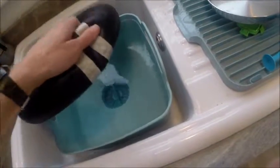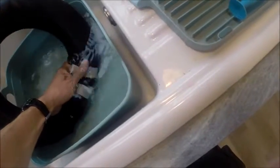In this instance I know where the puncture is. If I put this underneath and squeeze, you can see straight away — what you're trying to find is the location of where the puncture is. Once you know where it is, mark it up just like I've done here with a bit of tape. That's the first step: find where the puncture is.